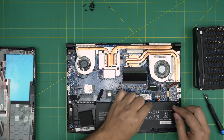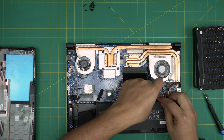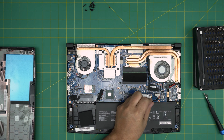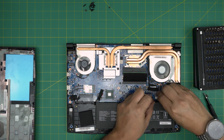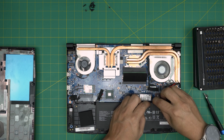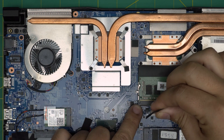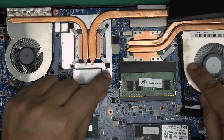If you want to be cautious, you can pull the battery jack straight backward to disconnect it, but I don't recommend it — you can just leave it there. I'm going to remove this shield on top so you can see the RAM slots better.